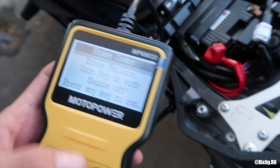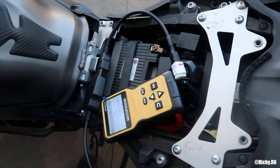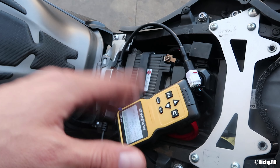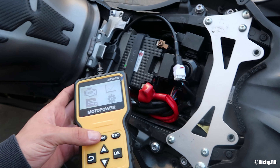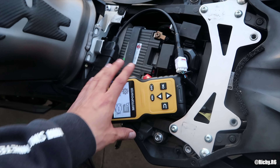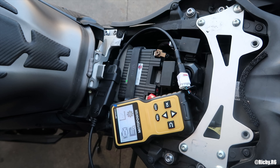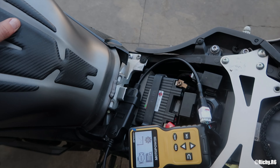Click yes. There you go. Now that everything's done, go ride your bike again and see if the code comes back. If the code comes back, that's for sure an issue. If it doesn't come back, it might just be something that set it off. Or instead of erasing the codes, you can back out, figure out what that is, solve it, and then erase the code and see if it comes back. Usually I erase the code first, but it's all about preference. Anyways, take care guys, see you later.